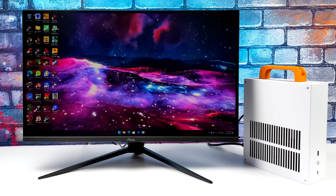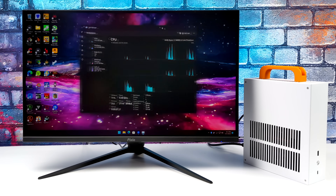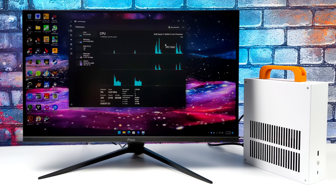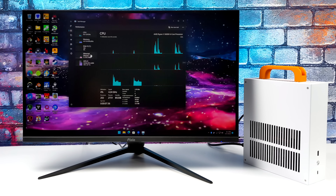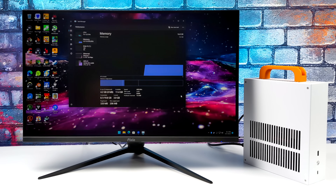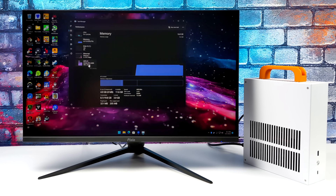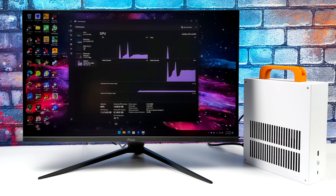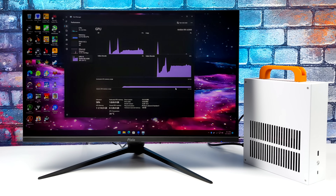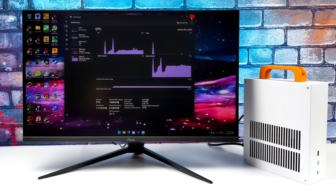I've done a little bit of testing so far — not bad. I did limit the CPU TDP to 65 watts because we are using the X variant, and we've only got 200 watts of power for this whole unit. By the end, we'll also take a look at total power consumption. We've got those six cores, 12 threads, 16 gigabytes of DDR4, and I have overclocked this to 4,400 megahertz. And of course, the RTX A2000 — with this we get six gigabytes of GDDR6 VRAM, and it does perform really well. You could leave this at the stock clocks or do some overclocking. With around a 300 megahertz overclock, it outperforms that RTX 3050. But with all that out of the way, it's time to see how this thing can really handle gaming.